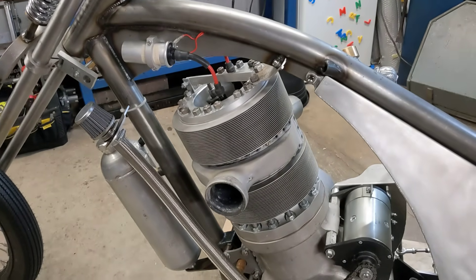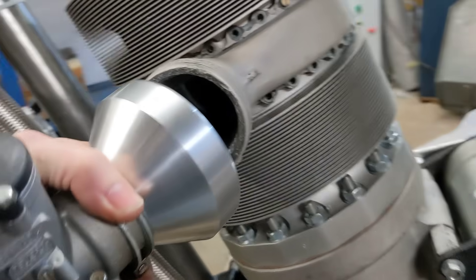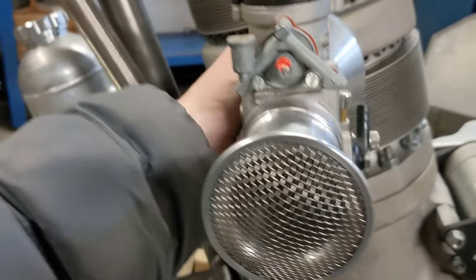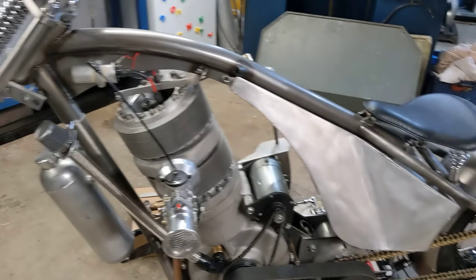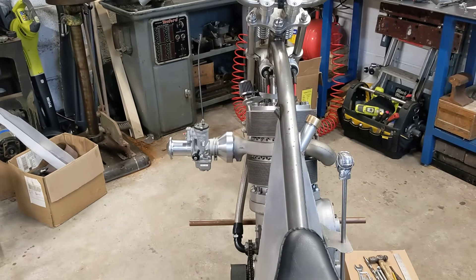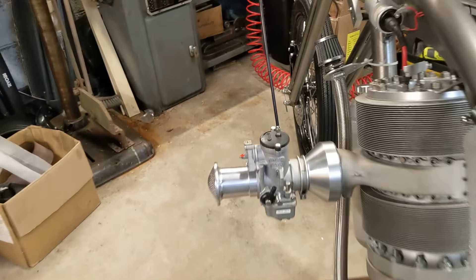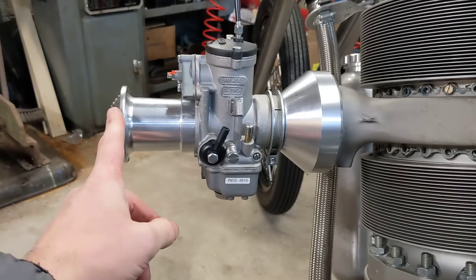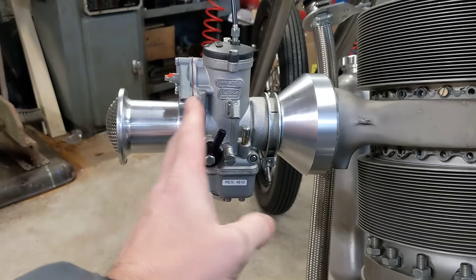There is the last manifold — that's quite a bit shorter and as you can see it comes straight out of the side of the bike without going around any bends, which looks quite neat. That would put the carburettor coming straight out of the engine. In their wisdom — only Bristol know why — this isn't the same thread or diameter as the other manifold; it's quite a bit bigger. While the threads will hold it in place I wouldn't leave it like that; we'd have to remake that piece. It does stick out quite a way and I wouldn't want to filter through traffic with that on, but it could be shortened by the distance of the taper and by fitting a pancake air filter.